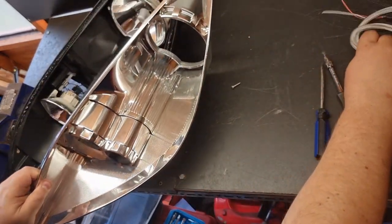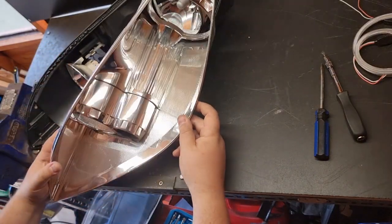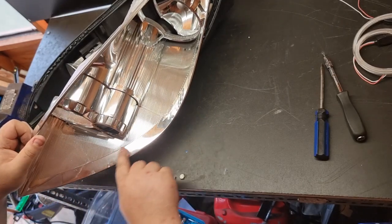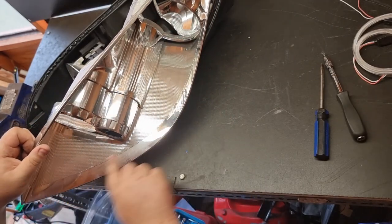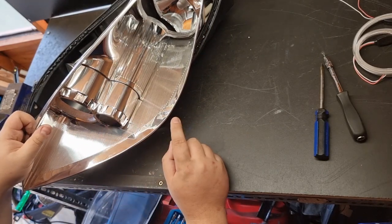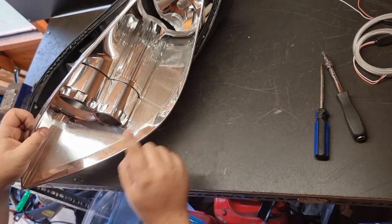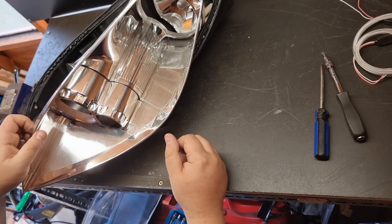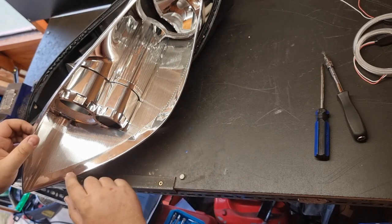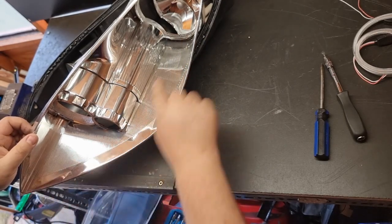Right, and another idea I've had, again, which I've seen people do on the Owners Club, is to fit a long LED strip here, which is a switchback LED. So I'll splice it into the side light circuit. So that'll be a constant white DRL. And then when the indicators are then turned on, it'll then be a sweeping sequential, I suppose is the correct term, indicator starting from the front, going up the top.